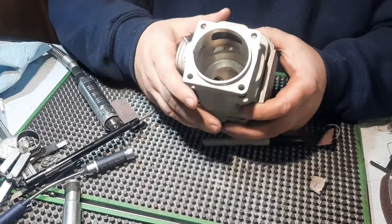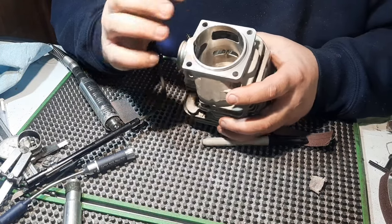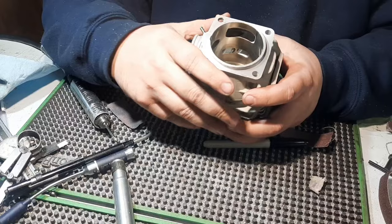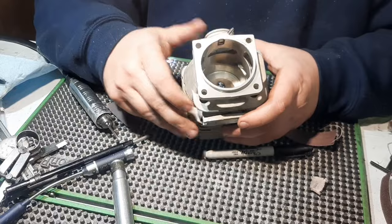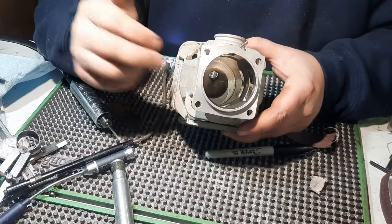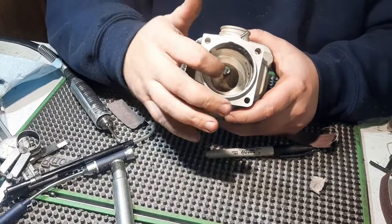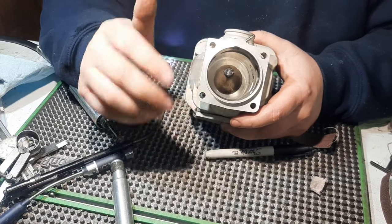Most all the cylinders, very similar. Good idea to practice on stuff that's not important. Biggest thing - make note of which way your cutters are going. Try to keep the chatter down. Try to keep firm, even pressure. Make sure you're not changing angles too much. I try and scoop these uppers out to where they have a nice flat roof where they exit, and reach in as good as I can and blend it all back in. If you just change port time right at the cylinder wall, you're kind of defeating the purpose a little bit, because you have an abrupt edge that it flows over.